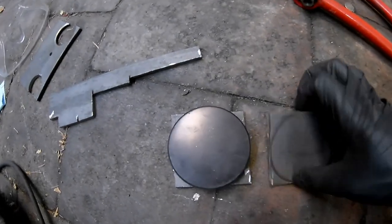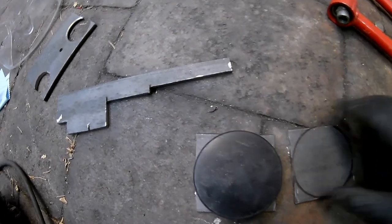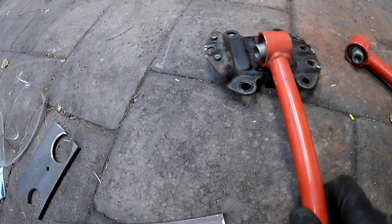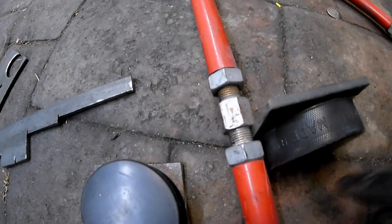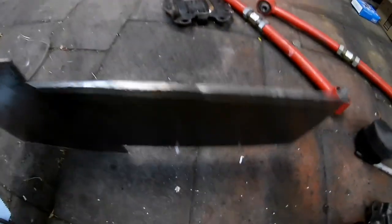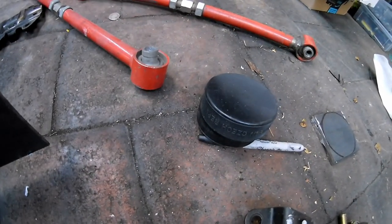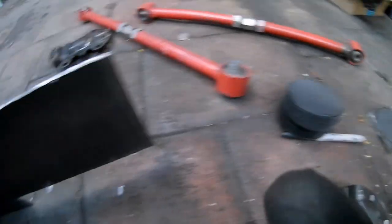Okay so there you go, plates. If you're looking at the engine, I'm going to come down here, be welded there. There's the cross member - that's quite a bit thinner but I do want something that is up against the cross member besides just that, because the cross member is significantly smaller so it would dig into that part of it. So I'm going to back it with metal.